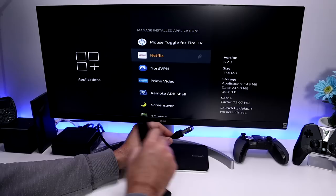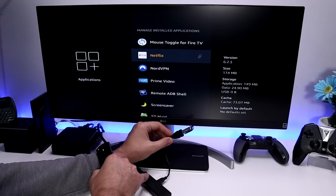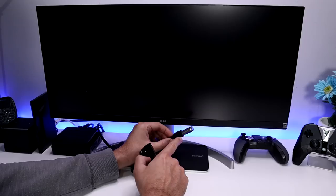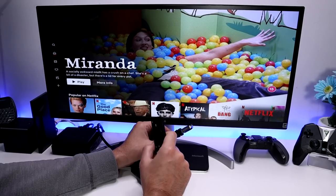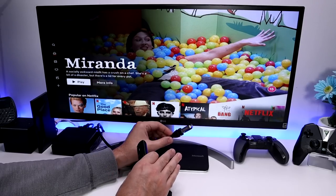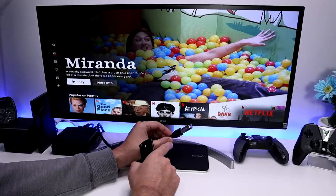One of the biggest issues with the 4K Fire Stick is that you really get no storage whatsoever, and there's no real way of expanding it — until today. Click launch and this is now opening from my USB drive, pretty much instantaneously. In this video, let me show you exactly what equipment you need and the process to migrate all your installed applications onto an external USB drive.